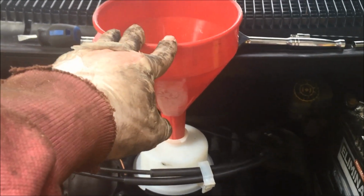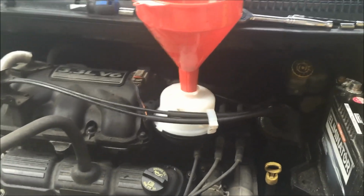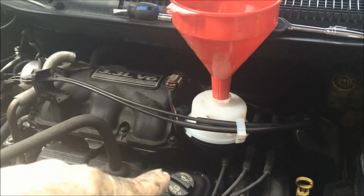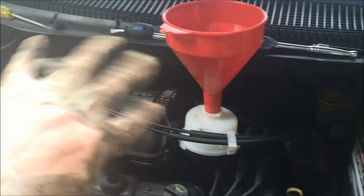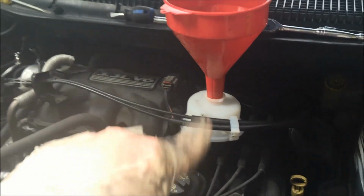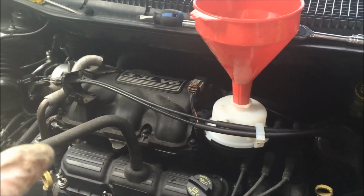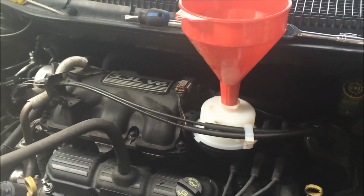I'm gonna take my power steering fluid and fill this up, and then this is a 2 or 3 step process, because the fluid needs to get pulled into the circuit, and then you need to bleed it, which you do by rotating the wheel and just running the car and letting the fluid circulate through, and you'll see air bubbles popping up in this. Perfectly fine. You don't need to bleed it the way you do brakes or anything to keep vacuums. You just don't have to do that. All right, so I'll get going with that.